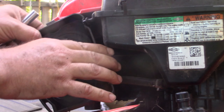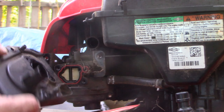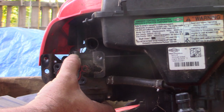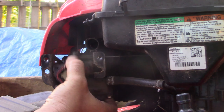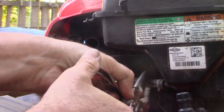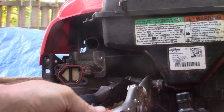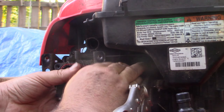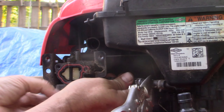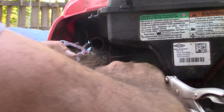So he comes down. This is where the breather assembly — the breather tube — plugs into the back of it, so just move it out of the way. Now the carburetor's loose and you can kind of pull it out. But what I want to do is clamp off the fuel line right here, and then I'm going to take a pair of pliers and move that fuel line clamp out of the way. All right, so I've got to take that hose off — like so.